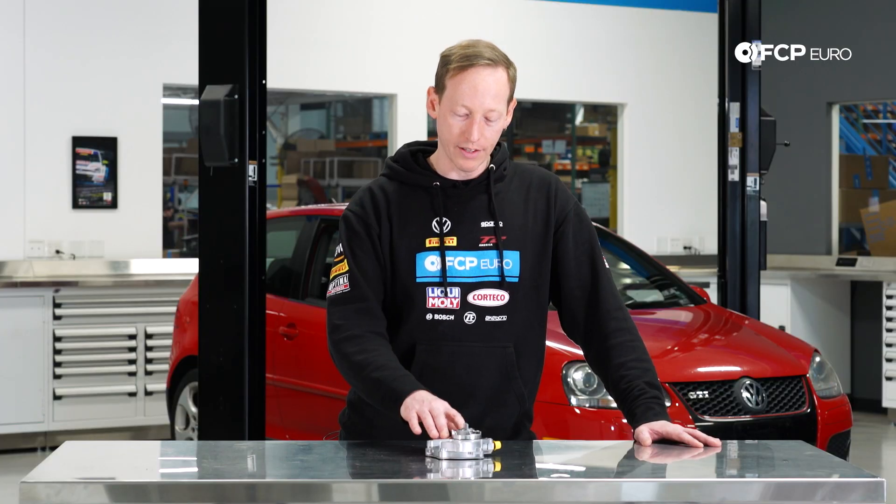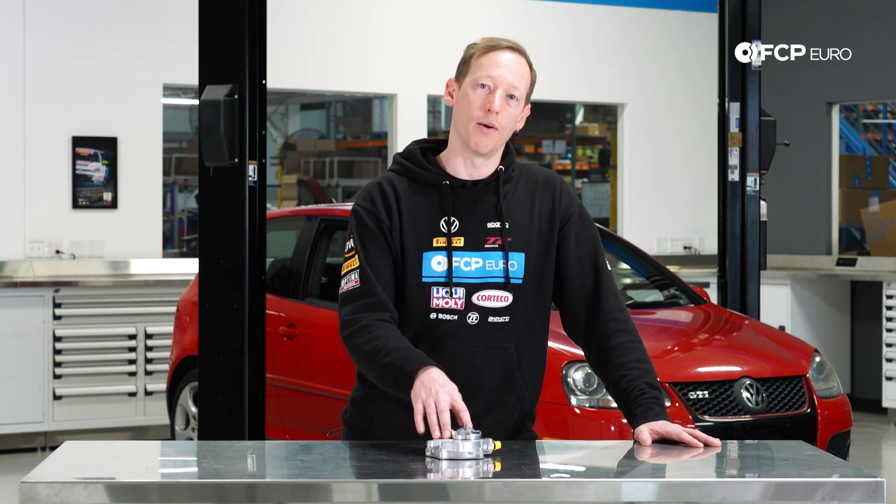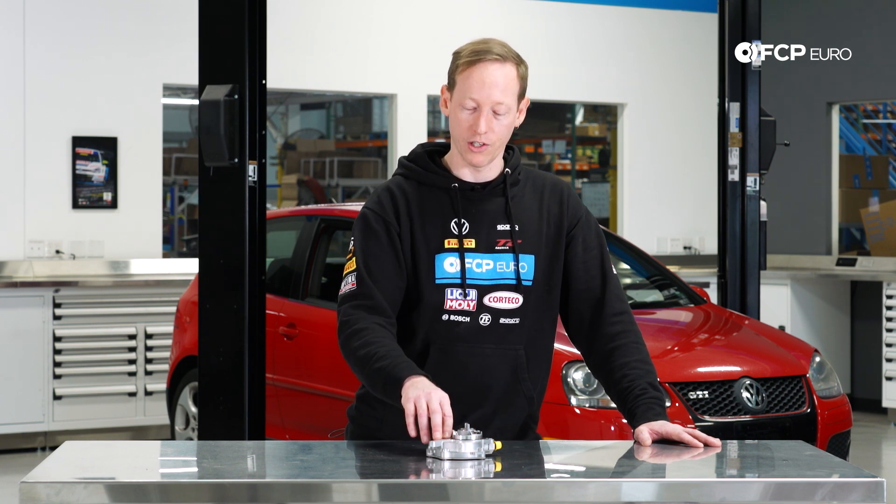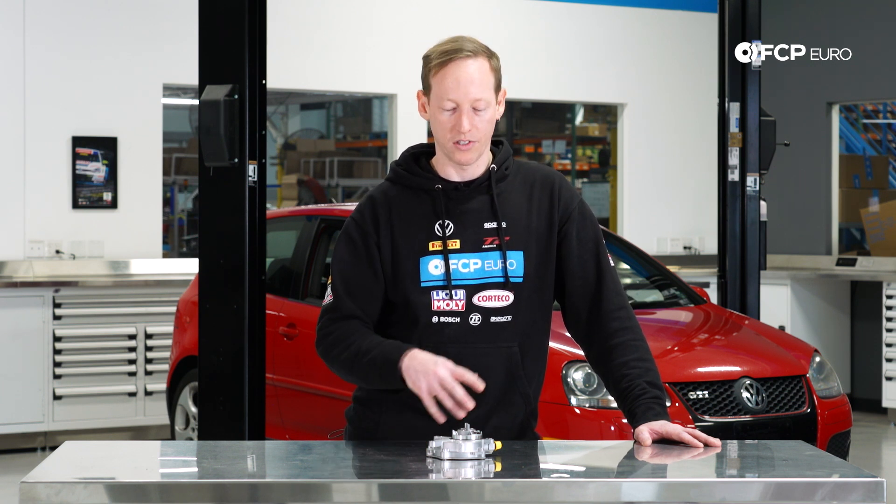It's a super easy job and very simple to replace. It is worth noting that there are two different seal designs on these pumps — there's an early and a late. The seal is specific to the pump, not to the head. So when you're replacing the pump, it automatically comes with the updated 117A seal. The 117, which is a slightly larger design with a different look, is only specific to that earlier pump. So if you're replacing the entire pump, it comes with the O-ring and you are good to go.